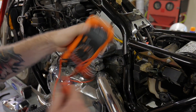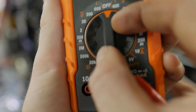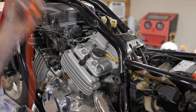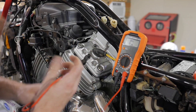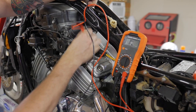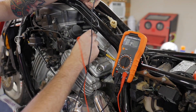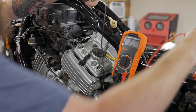We're going to take our meter and go to ohms, or resistance — that little omega sign. We're looking at somewhere around the 200-ohm rating. Now I'm going to take my meter, set it to ohms, and probe on the stator side. We're going to touch one of these yellow wires to ground and make sure it does not have a connection to ground. Make sure you are making a good read on that terminal. Is it grounding anywhere? It's not. This whole motor should be grounded, so next wire — there's three of them, three different checks. None of this is grounded.